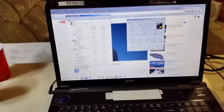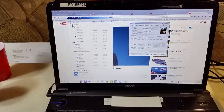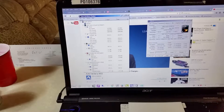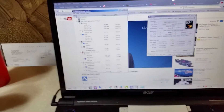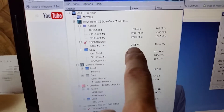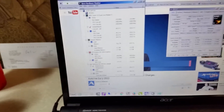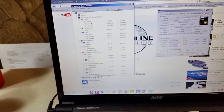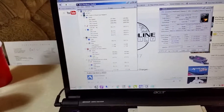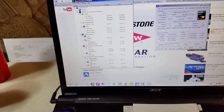I've been having some laptop trouble so I'm going to attempt to fix it. I've had it for several years but it just keeps getting hotter and hotter. I downloaded a program that tells me the actual CPU temperature, and right now it's sitting at 95 Celsius, which is over 200 degrees. That's just too hot. The max temperature on the CPU is 100 degrees — we're just under that — and I'm getting occasional blue screens and freezing.